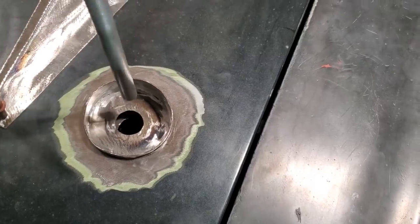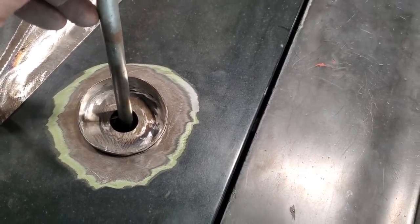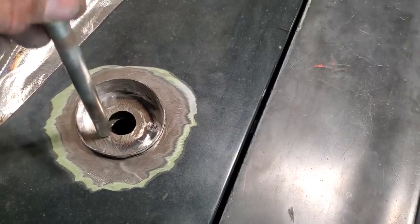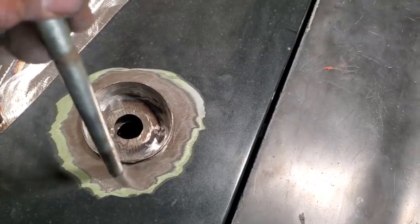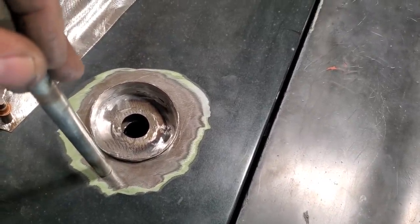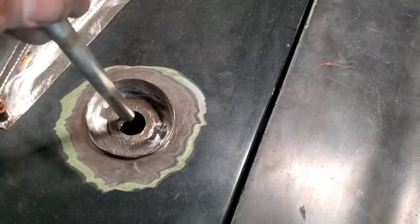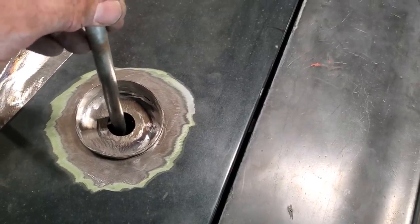So what I'm going to do here now is let go of the lower brace. I'm going to size that up to where it's at, and adjust it to fit what I've got done here. Because if I have to move this back, I'm going to have to put a big sliver in the hood. This whole front section of the hood will be back to about here, and there'll be almost a quarter of an inch gap on the bottom side. So I just assume that bracket is adjustable, and I can probably modify it a bit to make it fit.